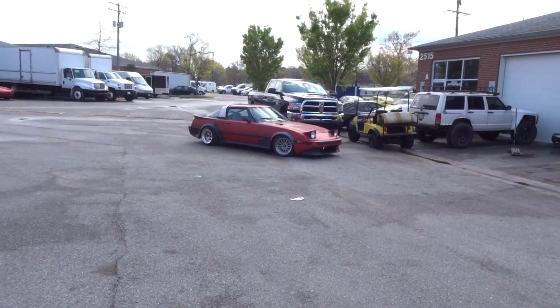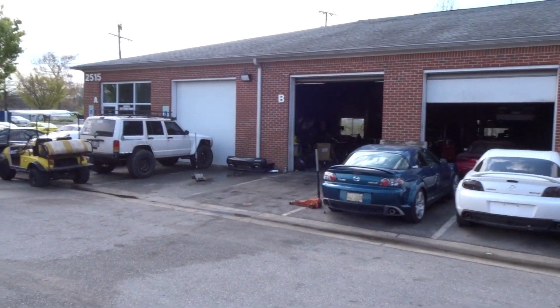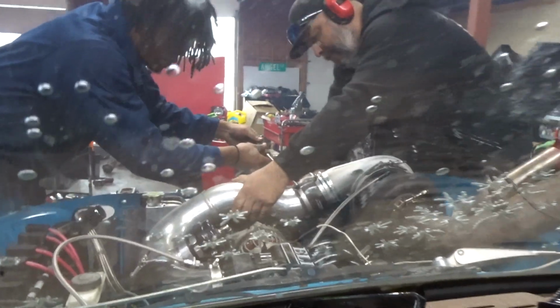But I'm hyped for the first gen and the Repo. The Repo, I haven't driven it in a long time. All right, so first hit, the pipe coupler came off, so that's the only spot we don't have T-bolt clamps, so we're gonna have to find some T-bolt clamps to put there.